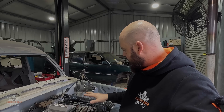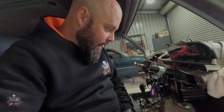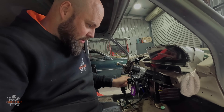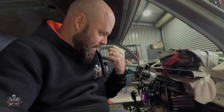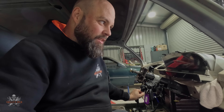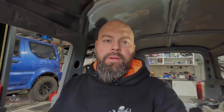Fuel lines are on. Intake's on. There's no wires near the exhaust manifolds. I think everything in the engine bay should be right. In here I've plugged in the dash and the ignition switch. I've taped off all of the loose connections that are positives. Managed to pull out the fuel pump wiring out of the Commodore — literally just plugged that up and terminated it. Plugged in the shifter. It's got fuel. There's not going to be no movie magic here — this is literally the first fire up. Come with me on the journey. If it works, great. If it doesn't, well — here we go.